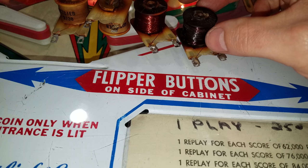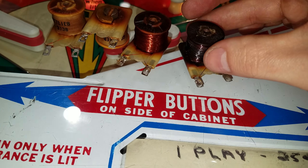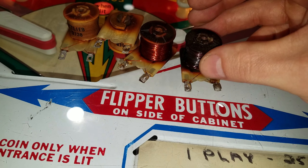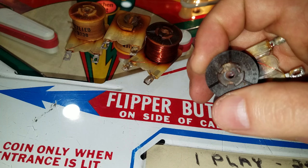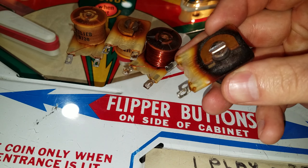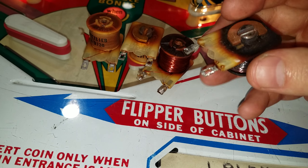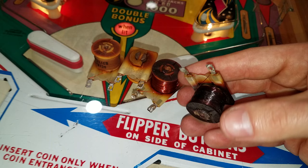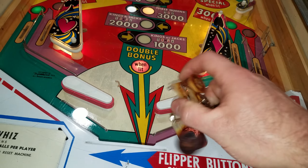It's hard to tell on camera, but all of these should be on a solid plastic bobbin. If you twist this one top to bottom you can see it's moving quite a bit — it's actually charred to the point where it's falling apart. This part electrically was still working, but after a while it might have gone completely open, or burned the varnish off the wire and shorted out.